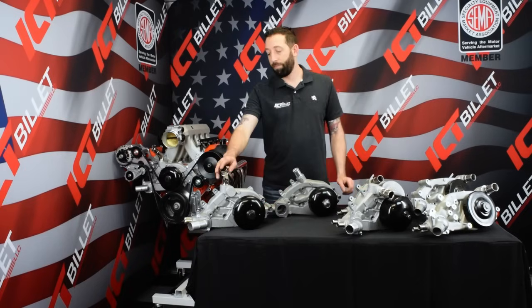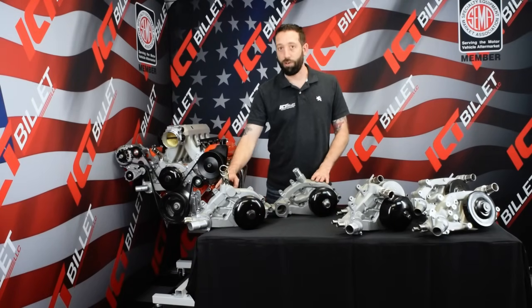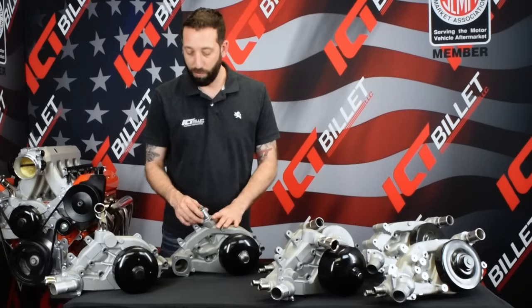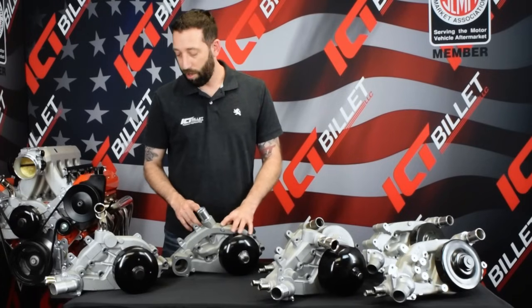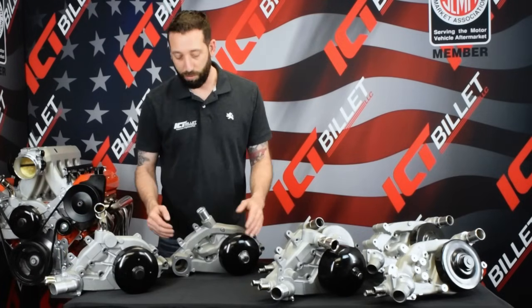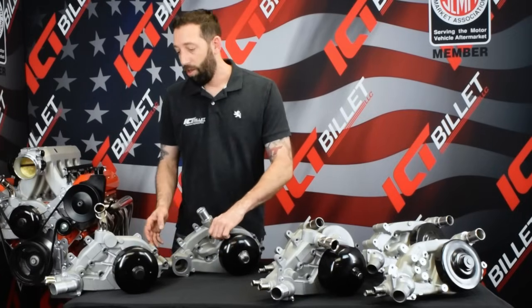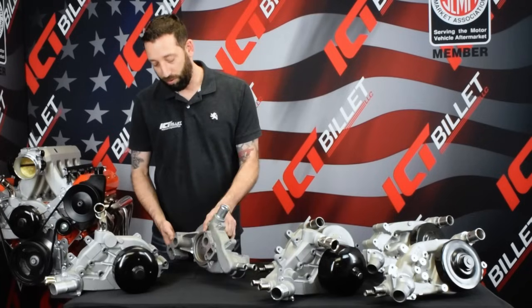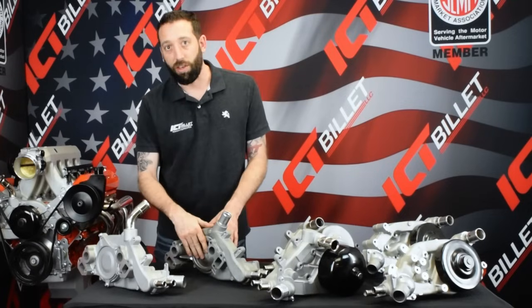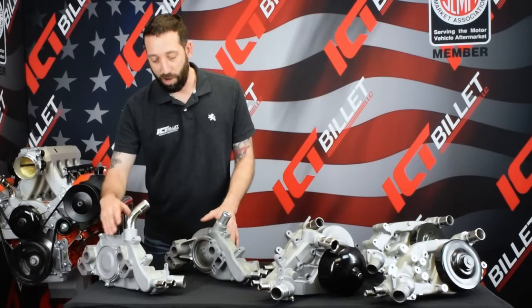Next, we're going to look at the water pumps. These are your most common pumps you're going to see in trucks and SUVs. Your older Gen 3 engines are all going to have this old swoopy neck here where it exits to the top of the radiator. This one's a lot shorter on the Gen 4s. They both have the same mounting height, so if you have accessory brackets that mount to it, these are interchangeable and the belt is in the same position. Most noticeably, if you have a VVT engine you'll need to stick with the newer pump because it's got this large recessed area — that way your timing cover sensors will have plenty of room. This older one is flat, so there's very little room to work with.